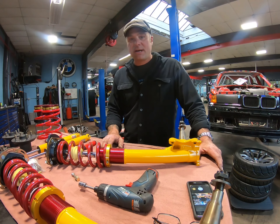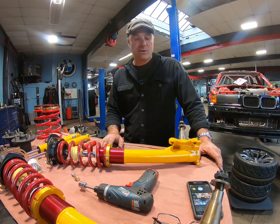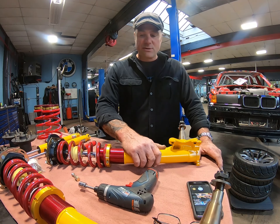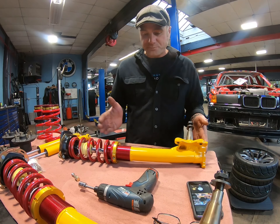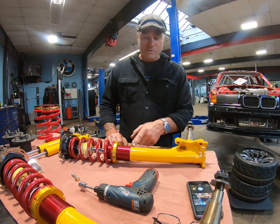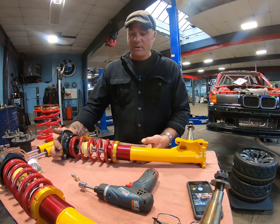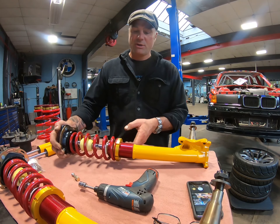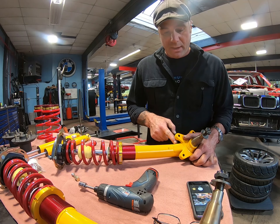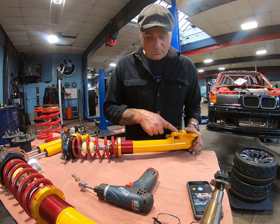I was able to rescue a set of TII struts that have been manhandled. They're a really rare piece these days and replacements are very expensive, so when you can rescue a set from the scrap bin, I feel good about that. You send them away to Ground Control and what they do is take the existing strut tube, cut off the top section along with the factory spring cup — the larger diameter spring cup — and they weld their own spring perch onto it and put a threaded collar over the top so you've got a ride height adjustment on the bottom of the spring. This threaded area will change the height of the perch and the ride height of the car. They weld in a reinforcement piece — a little triangulation piece from the strut tube to the hub flange — and then powder coat the whole thing.